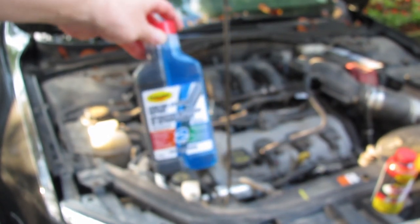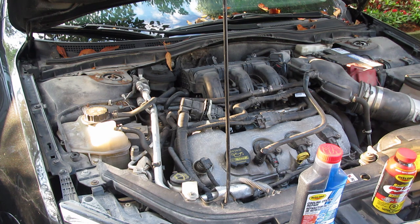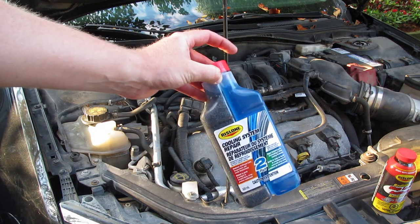One issue is that if you add that to the overflow tank and go for a really short trip, or the engine doesn't get up to temperature and the thermostat doesn't open up, it's not actually going to circulate any of that stuff from the overflow tank. But we do drive up to 60 kilometers — about 40 miles — each way to work, so we're going to be using the system to its full potential and circulating through that overflow tank. That's why I prefer to add it right to the hose, but this product actually says we can add it to the overflow tank.